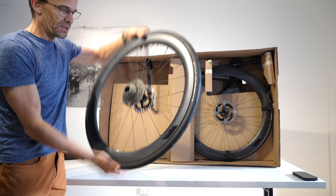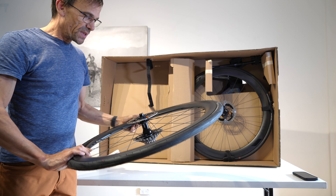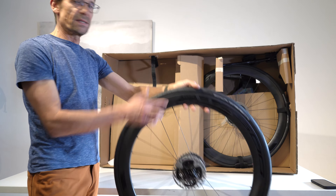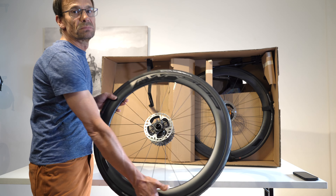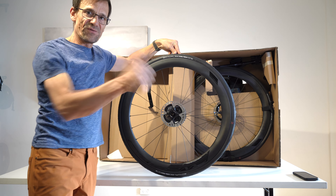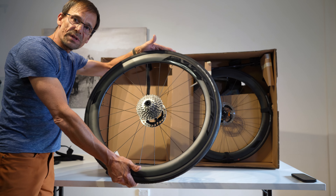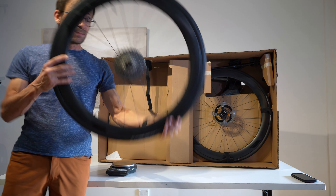Not tubeless yet — that's a tube valve with a huge extension. All combined, this wheel as you see it here, complete with 12-speed cassette, rotor already installed, with the DT Swiss patented lock ring — that's a 140mm rotor. The wheels are Entity — it says Entity WRS 500 or something. There's a little bit of pressure in those tyres already. Schwalbe 1s — fantastic tyres — and they are 28mm. So Schwalbe 1s, 28mm, tubeless ready but currently tubed. Wheel weight: 1,660g total — 1kg plus 660g — as it is, without sealant, with tubes.